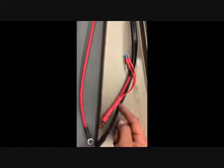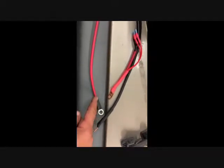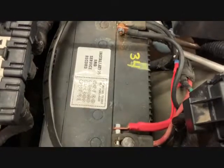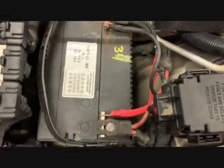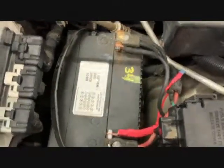And here they are complete. We've got a dual wall adhesive line heat shrink seal on the same thing on the power, and we got our two accessory wires for battery powered accessories. You can see how much nicer it is — see how much more heat shrink I use compared to the original. It's cheap, you only get one chance; the more you seal it the better off you are. These connectors will be packed with dielectric grease. Our battery connections are complete, nice and neat.